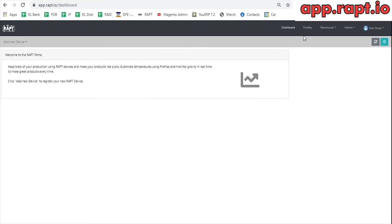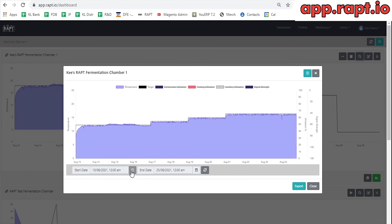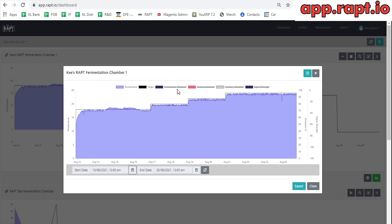Once you've got a profile running, going back to the dashboard on the device, you can zoom in and get a better idea of how well your device is operating. If I click on the magnifying glass I can go back in time — back a year, for instance — and see what temperature profile I used for that winning recipe I entered at VicBrew so I can replicate it on my next brew. I can also check compressor utilization — how much the compressor has been turning on. If I hit this checkbox, it shows compressor utilization on the graph as an overlay.